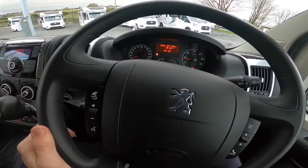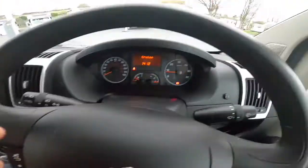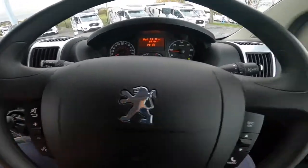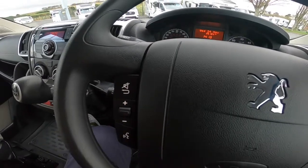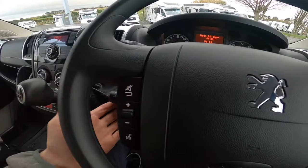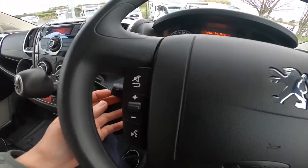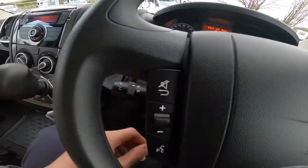If you're on the motorway, you can pop the cruise control on — turn it on and you'll get the little green light saying cruise control on. Get your desired speed by accelerating using the pedal, then just push it up and it'll keep that speed. You can push up to speed up or pull down to slow down. Cancel with the foot brake or cancel with the end of the stalk, then push up to reset.